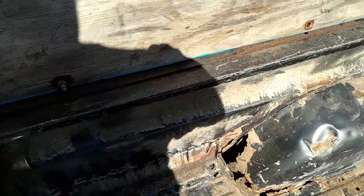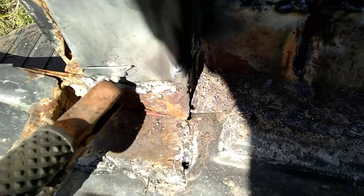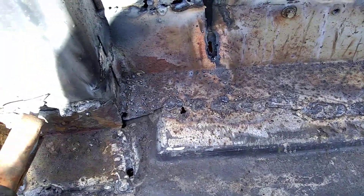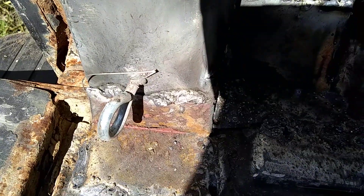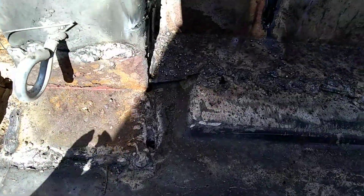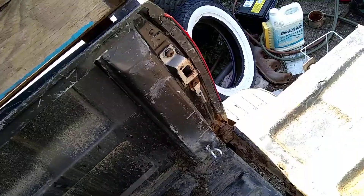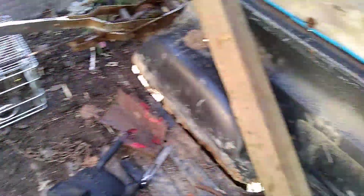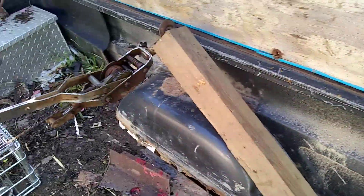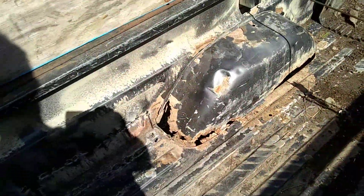So I started on it. I got some holes burned in here, and some of them were actually in the metal already. I put a main brace there. I had to slide this whole corner over about an inch and a half, so I welded hooks there. I tried just screwing them in and they came right out, so I welded them on both sides and hooked the come-along to them. Drew this side over — this side is still fairly solid. I'm going to fix it all right where I'm working on it. Got that pretty much square.